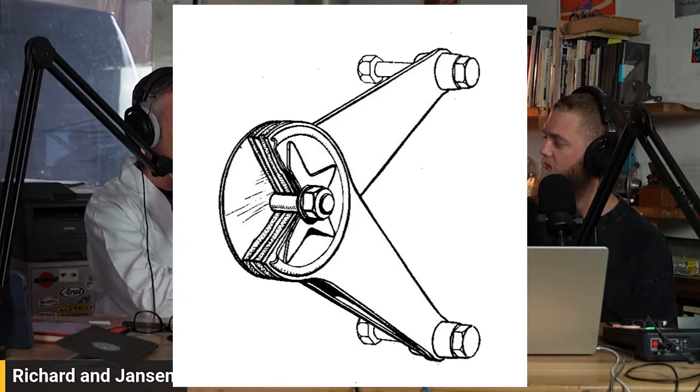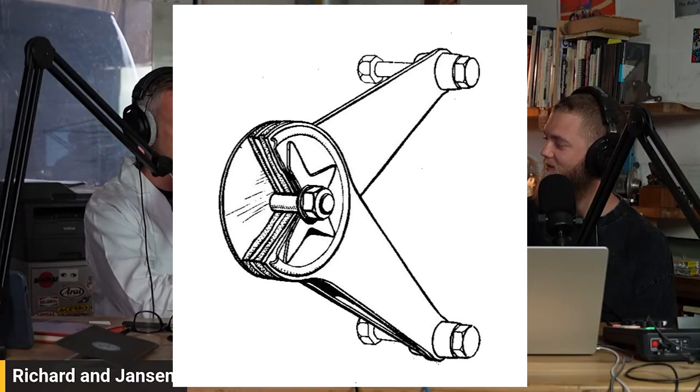Springers and girders traditionally did not have any liquid damping. They may have had mechanical damping, accomplished by plates where you could adjust the tension to provide friction damping. We don't have time to go into why that isn't ideal — it does work for damping and prevents oscillations, but it also makes it harder for the suspension to work effectively.